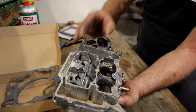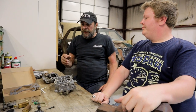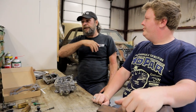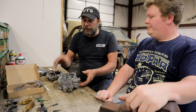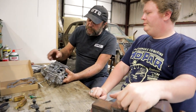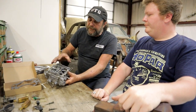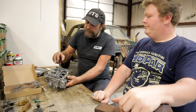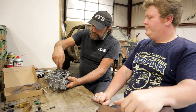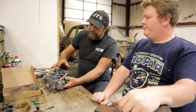If you've got one of these carburetors and you're either not getting full throttle like you're supposed to, you get into the secondaries and don't feel or hear anything different, or you get into the secondaries and it just falls on its face — there's a good chance you have the problem we found with this one. Make sure this sucker is free and has a free fall. You don't have to have the carburetor apart to do this; you can just reach down and give it a shove.